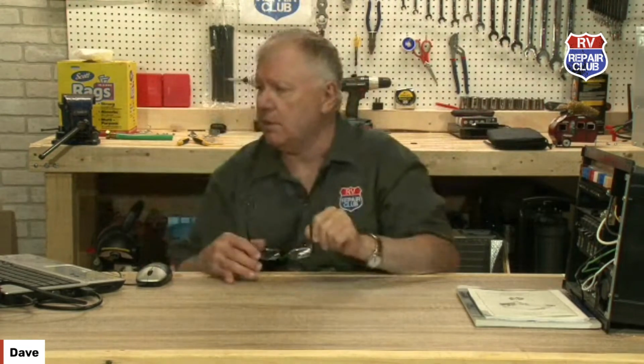Then we took a piece of paneling the width of the side and 4 feet wide, put a couple 2x4s against it, and let that cure for 3 or 4 days. Then we came back, trimmed off the excess, and screwed a piece of wood trim up there to hold it in place at a couple different levels. We even replaced the white vinyl trim with wood trim, because it was stained the same color as the side, and it looked factory installed. It lasted 2 or 3 years till we sold the unit. It was my folks' unit, the first one we did.